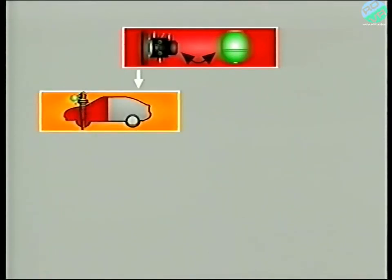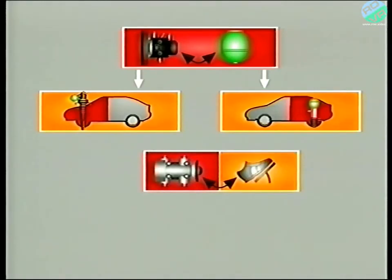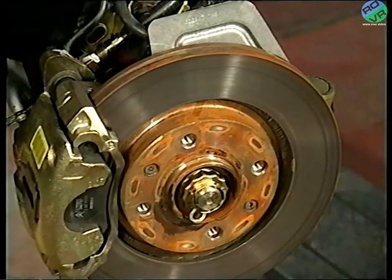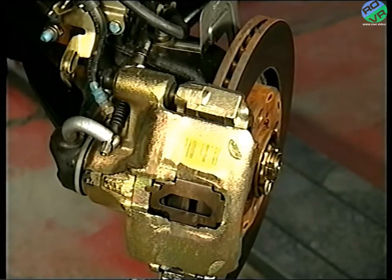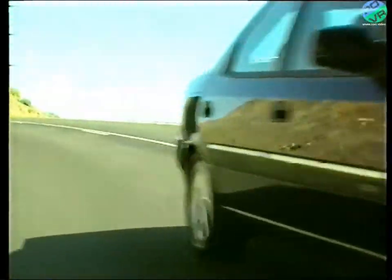Now to recap — here's another way of looking at the system we've explained so far. Our source and reserve of pressure directly feeds the front and rear suspension. The brake control valve has two circuits: it receives system pressure from our source and reserve and makes this available for the front brakes, and its other half receives pressure from the rear suspension to supply the rear brakes. Note that the hand brake works on the front wheels. The hand brake cables connect to the front brake calipers and the linkages push the pistons and in turn the brake pads against the front discs. Citroën are the only volume car manufacturer to use a power braking system.